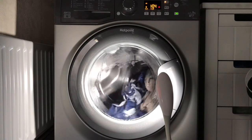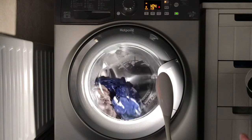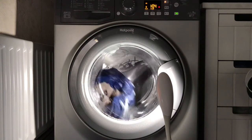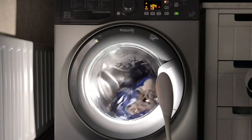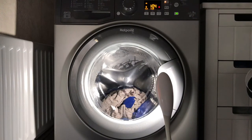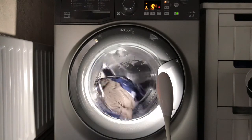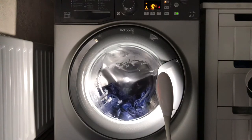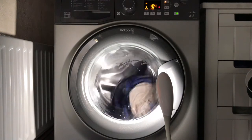I'm also going to show rinse and spin programs on both machines. The Samsung is complicated — you can do separate rinse and spins for each cycle if you hold the rinse or spin button down. For example, Super Speed spin-only is eight minutes, whereas a normal rinse-and-spin with the rinses removed is 30 minutes. On synthetics, holding the rinse button does a rinse-only for that cycle, which isn't mentioned in the manual.